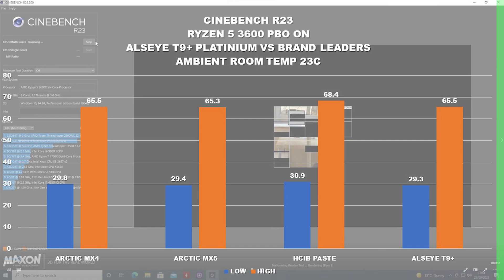Low temperatures are excellent, and it's always nice to see a low idle temperature. But the more important thing is what it's like under load. The fan profile for the 360mm AIO was a normal everyday profile: 40% fan speed at 40 degrees, 60% fan speed at 60 degrees, and 100% at 70 degrees Celsius. So these results are getting towards that 100% mark, giving a pretty accurate indication of what real-world use is going to be like.